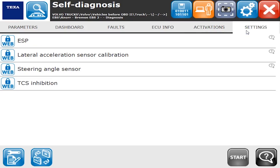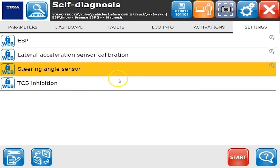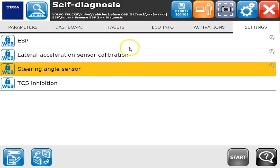We're going to show you a couple of these real quick. The short story is what EBS does: it basically monitors the brake pedal, and then sensors look at the wheel speed and brake line to determine how hard to apply the brakes on each wheel end. There are calibrations that need to be done, and the Diesel Laptops system can do all of those things.